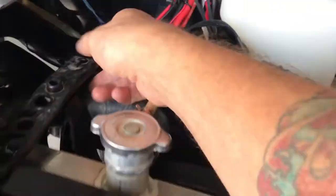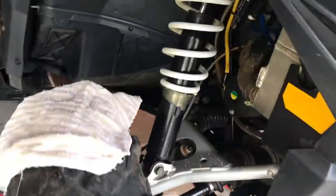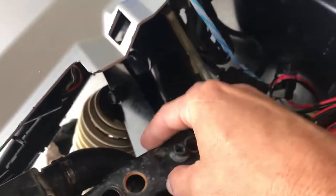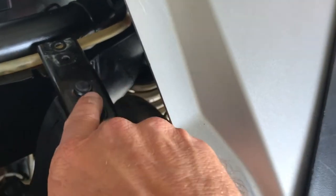The fan did come with a broken tab right here. What I'm going to do is take the rubber bushing, trim the top of it down, stick it through that hole, drill a hole right there, and bolt it in. On this side, the stud just goes through the rubber bushing and pops into the radiator mount. The other side I'll just have to bolt in — won't be a problem.